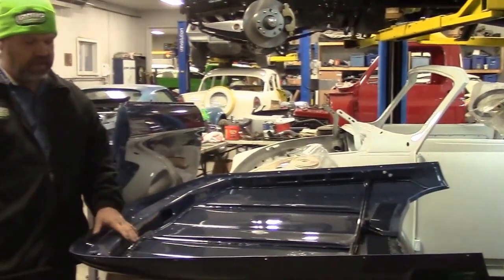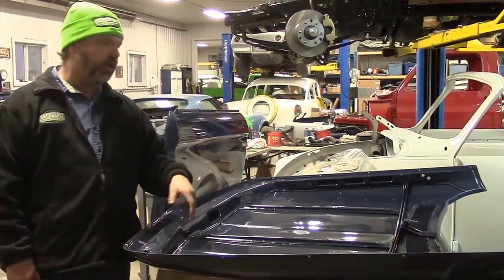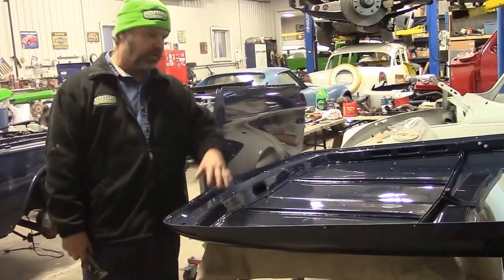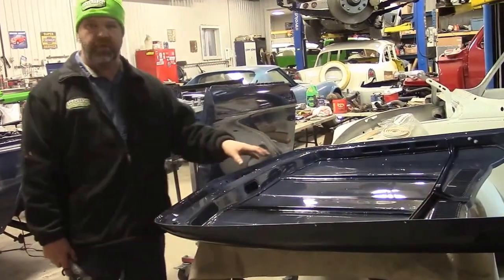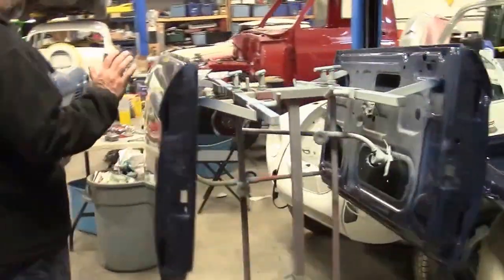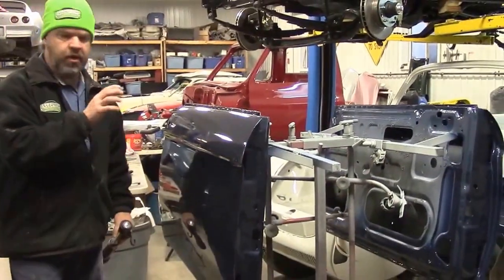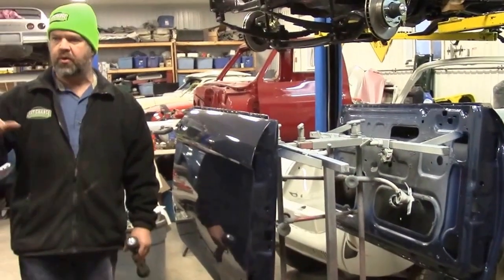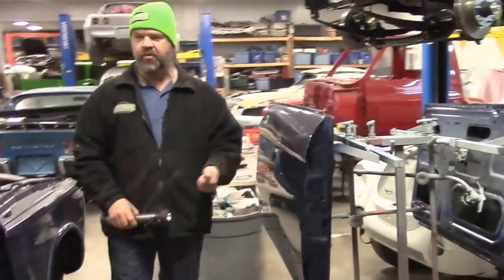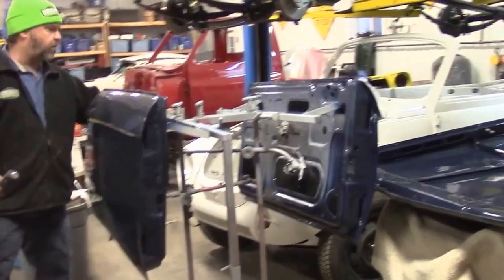All the separate components to raise and lower the hood have been cleaned and painted separately. Once they're painted, we'll put all the new hardware in with all the new bracing. You can see our doors are also done. When we painted this car — because of the metallic — we always want to make sure we paint everything all at the same time, so the body, hood, trunk, and doors were all painted at the same time with the same pressure and exact same mixture of paint, so we know everything matches. These doors turned out really, really well.